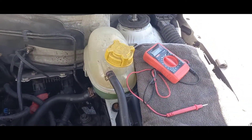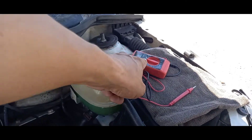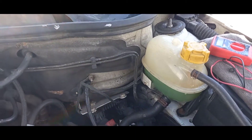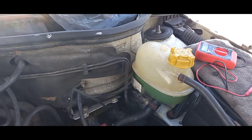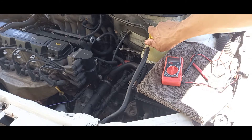The test we're going to do today will determine the efficacy of the coolant in the system. We're going to do a very simple test using a multimeter — have a cloth on hand and your coolant reservoir, that's basically all you need. If you're testing at the radiator, make sure the probe doesn't touch any metal parts of the radiator — that is vitally important. First, make sure the vehicle is at operating temperature: take it for a drive, come back, let it cool for about 20 minutes before opening the reservoir, as it will be under pressure.